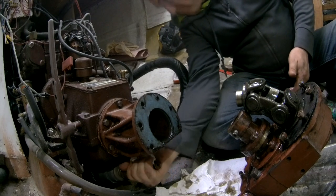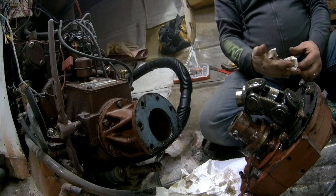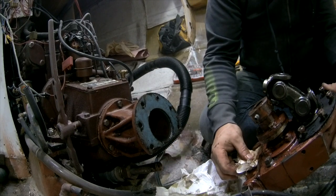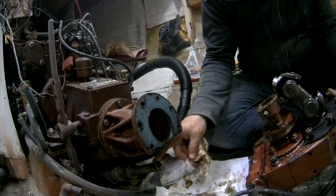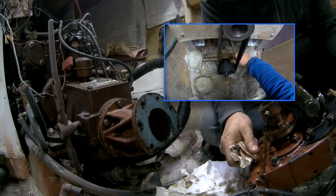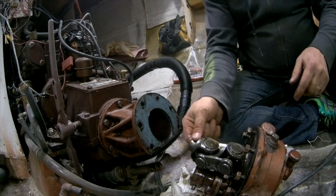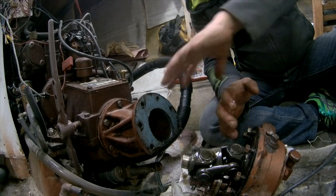That is where my propeller will turn freely now — both backwards and forwards. I can hear it turning. So when I put my electric motor in, it basically is just going to attach to that sprocket right there. So I can build or put a pulley on it — right on that shaft. Get something machined and then do a belt system. So this is just like a big universal joint to help control the angles a little bit.